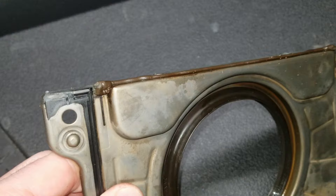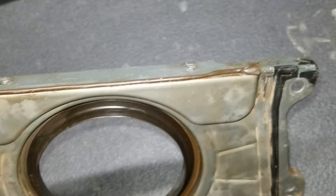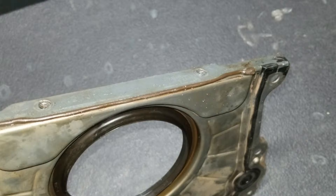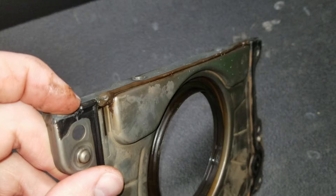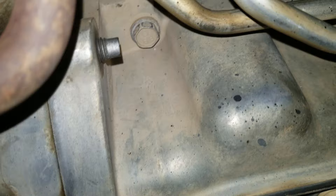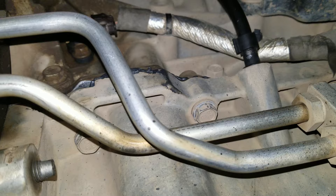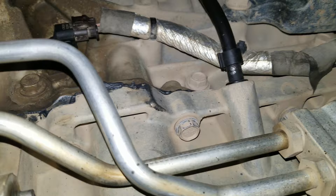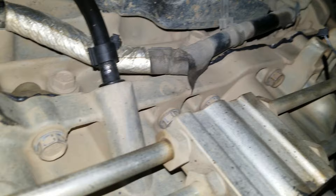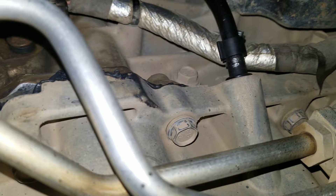What you're going to see when I get back under the Jeep is that we had to remake the gasket for the upper oil pan or the crankcase housing. My guess is that when you pull the rear main seal off there's a high likelihood that you're disturbing that gasket or seal around the back of the upper oil pan — and that's why we needed to fix a leak there as well. You can see the Pentastar 3.6 liter oil pan and the block on the right, the transmission on the left. Behind the transmission cooler lines is the gasket — my mechanic refers to this as the oil pan, I've also seen it called the upper oil pan.